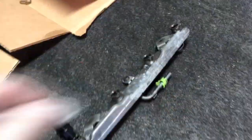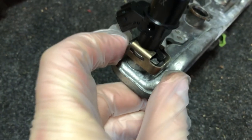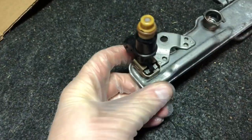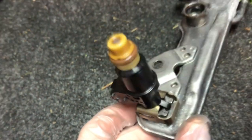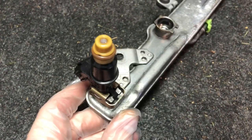I have removed the old fuel injectors from the fuel rail. The metal clips are easy to remove — just pry them outwards carefully because they will fling off and fly everywhere, so make sure you don't lose them. I have installed my Honda OEM fuel injectors which have been professionally cleaned, tested, and had the O-rings and filters replaced, so everything is brand new and working like new again.